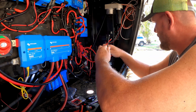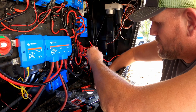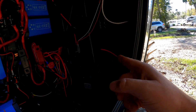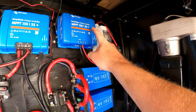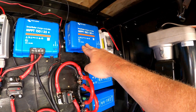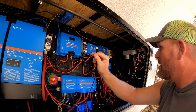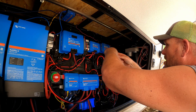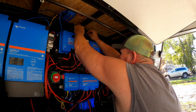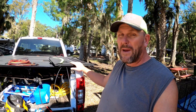Now we just have to put a couple of MC4 connectors on here, which is pretty simple. I'll leave a link to these tools in the description below. We've got the little pass-through wired right through here, then it comes up to our breaker, then out of the breaker directly into the charge controller. We'll have a couple of lines come out down to the Lynx distributor. Now we're just going to take our VE direct cable — this is how it talks to the Cerbo GX — it comes back up and plugs in. They're labeled.